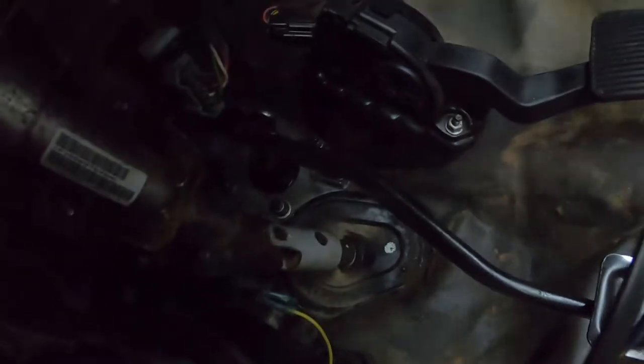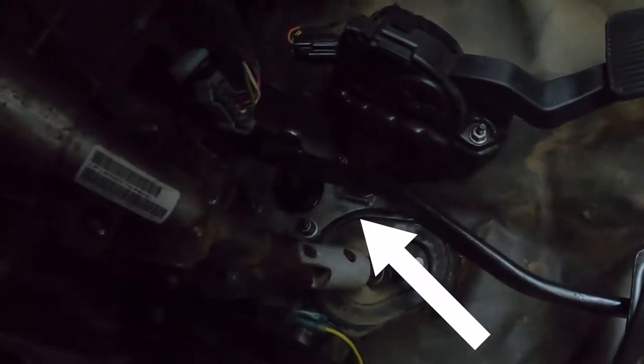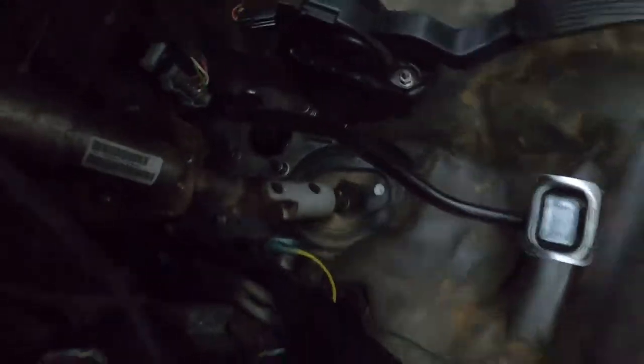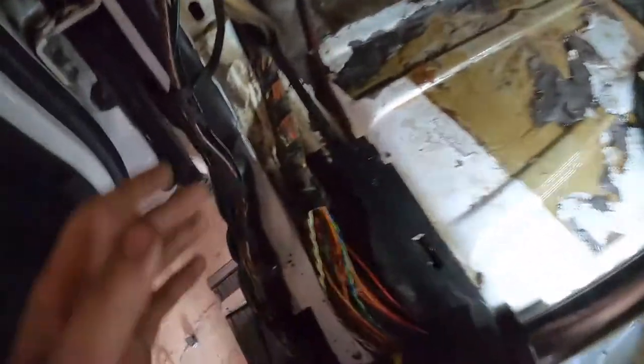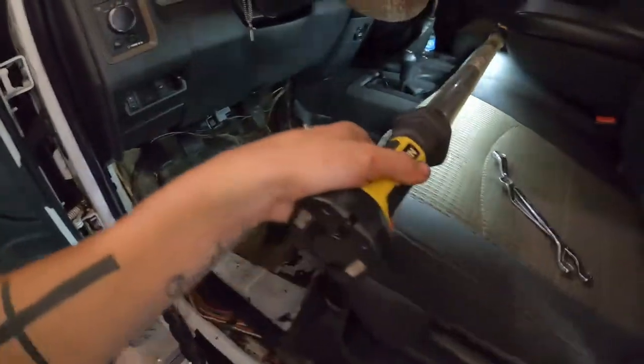It's up. The thing's up there if you can't see. Right in the middle of the view. There, right there. Where the brake pedal goes, boom. Yeah, well, it was leaking for a long time apparently because I already vacuumed this up, but man, there's a lot of fluid. And it was dripping on my step here, and I was like, what is that? It was ATF, because that's what they run in these. ATF plus four, if you're wondering.